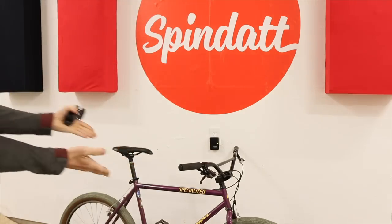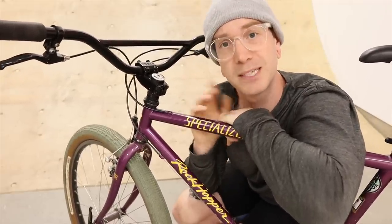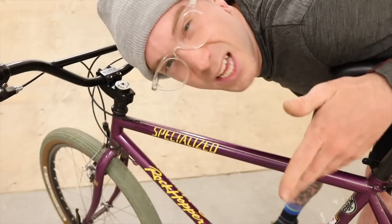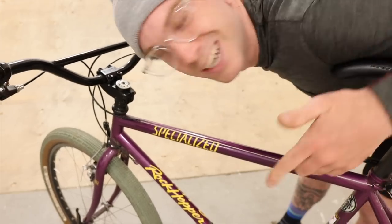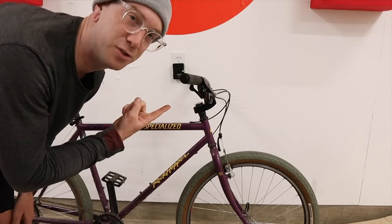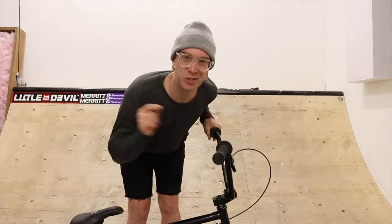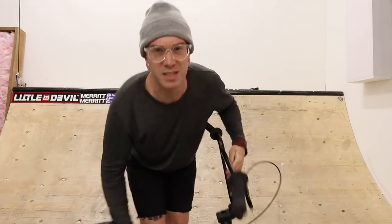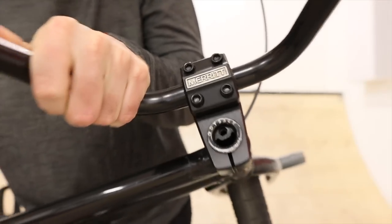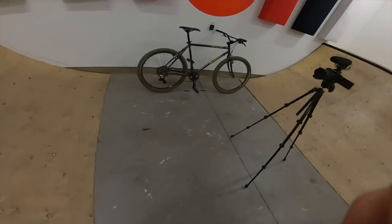What I much prefer is to run the appropriate style stem for this clamp diameter, which for the last 40 years or so just happens to be a BMX stem. I think it looks a little cooler. A lot of people do really crazy things with BMXs. If you're just cruising around on a bike, you know your bars aren't going to slip. Considering these are 3.25 inch rise and the bars on my BMX are closer to 10, a lot more leverage, these never move. If you're looking for a good stem, check out the link below to this Merit stem. I sort of trust it with my life.